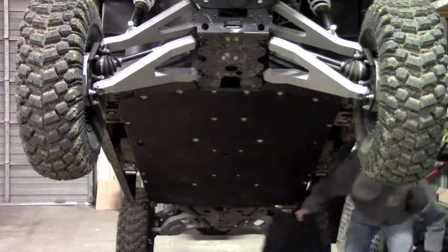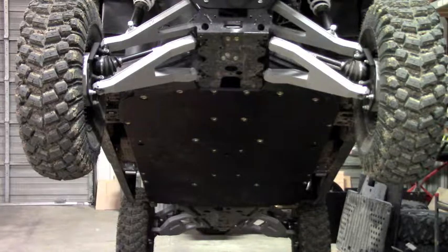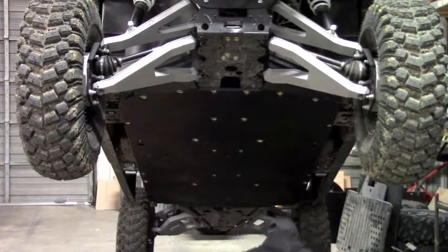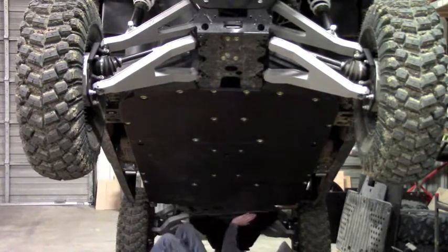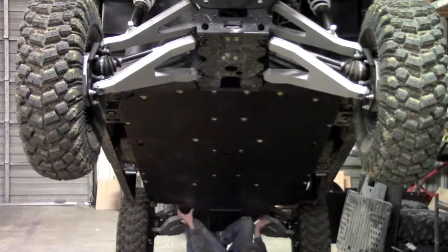That's this rear plate here. It's going to have 3 of the cup washers with the longer bolts for the front mounts. And then it's going to be the bolts and these nut plates for the other 4. So let's just start with the 3 common right for now. Get the plate into position. You're just going to bring it in, line the slot up with the hole, and start your bolt.